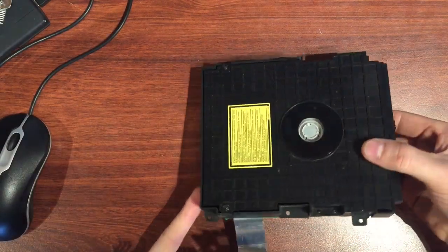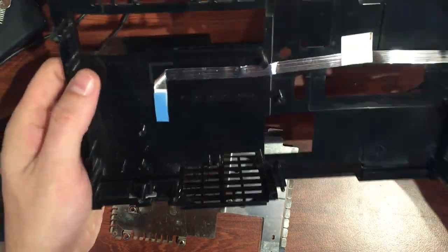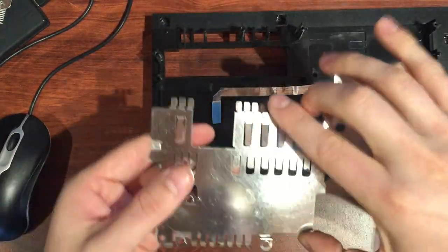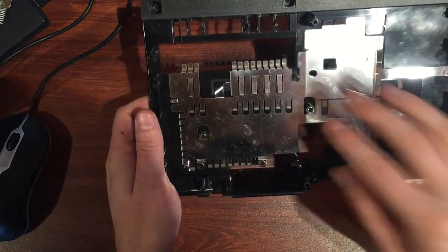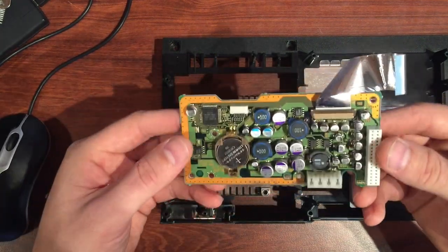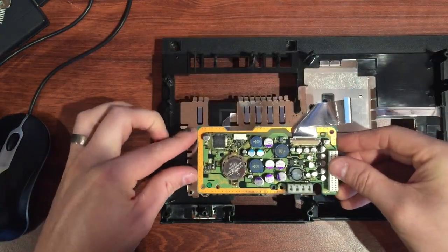That's back together. Now we'll put the unit aside for a second. You're going to need the middle section again — this is the section with the ribbon cable. Hopefully you've cleaned it all up. With the top side facing up and the blue ribbon across there, put that flat on the bench. Grab the heat shield or RF shield and put it in position — it sits back in here about there. Pull the ribbon up and through, making sure the ribbon is on the top side of the shield.